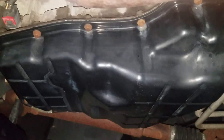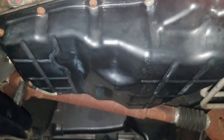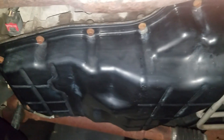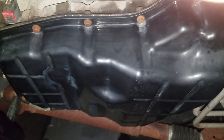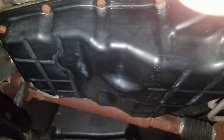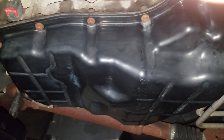A lot of people are going to wonder why I didn't go with an aftermarket deep pan with a drain plug — I totally understand and I did review and consider some brands. But at the end of the day, I know a lot of people with well over half a million miles on their 6.7s still running the stock pan, some still with the original transmission. It does the job and you don't have to worry about anything seeping out from a drain plug. This is my first service at 36,000 miles — I'll probably do this again around 70,000.